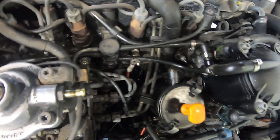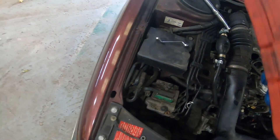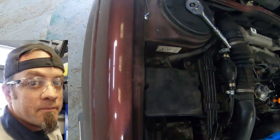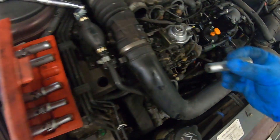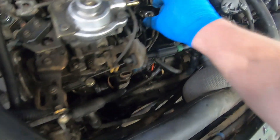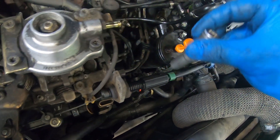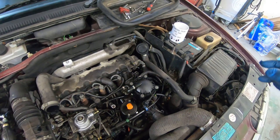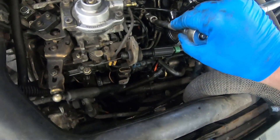That's the more modern way of doing these. Next I've got to pull them out. I have special glow plug sockets — you don't have to use these, but it helps. Let's see if these are 12mm — that was a good guess. It is literally just a case of undoing them. I'm not too bothered about the drop nut, by the way, because my new glow plugs come with new nuts.